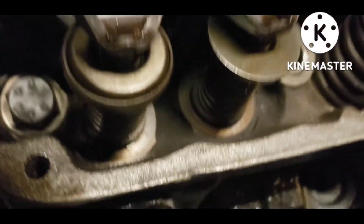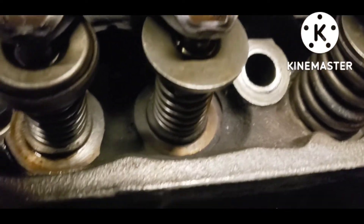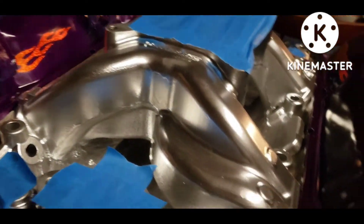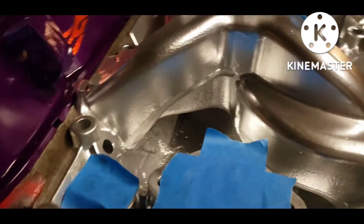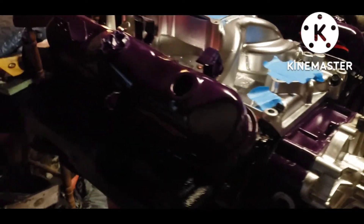I checked them out — I've got the small testing springs on it and checked the clearances. There's plenty of clearance; nothing's interfering. So I don't know if maybe I just got a good set of heads, something's different, or maybe the information out there is just wrong.